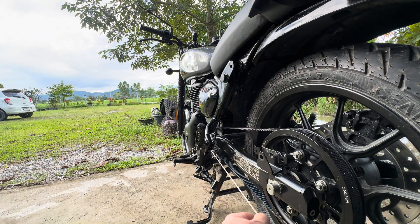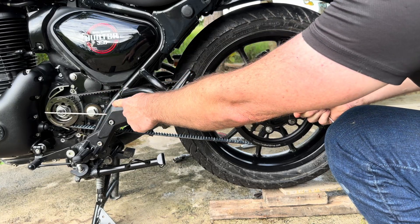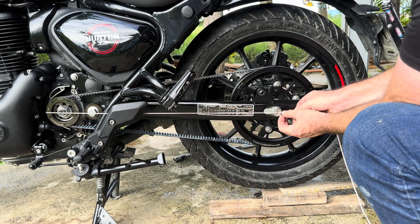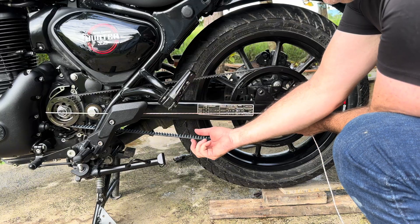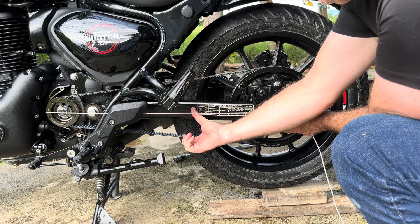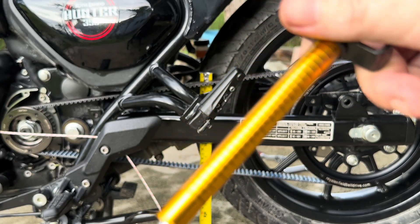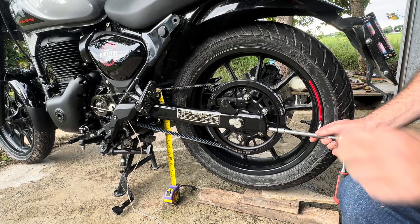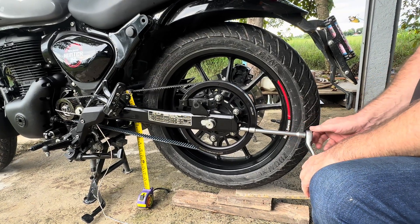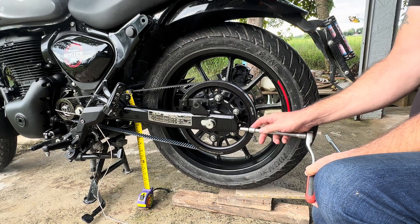I'm pulling the string out at 45 degrees away from the bike so it clears the frame — centre of front pulley, centre of front swing arm, centre of rear axle. I think that's a straight line now — this is when we measure the belt tension. We're going to measure to 10mm of deflection. We've got a belt tension tool set to 10 pounds with the rubber, and then we push up in the middle of the belt. If you're doing adjustments, sometimes just a quarter of a turn on the ratchet is enough — sometimes just an eighth of a turn.